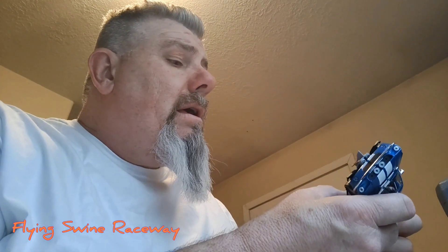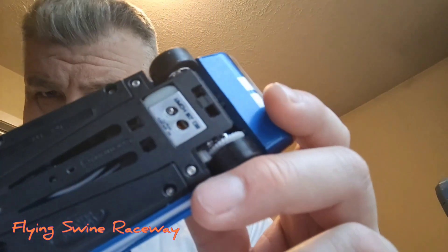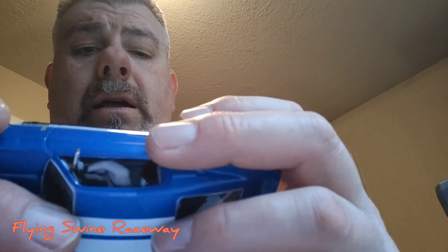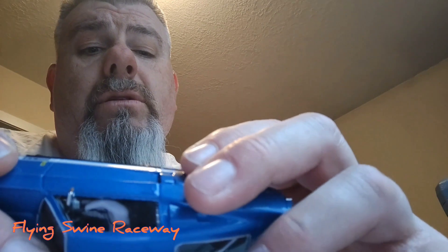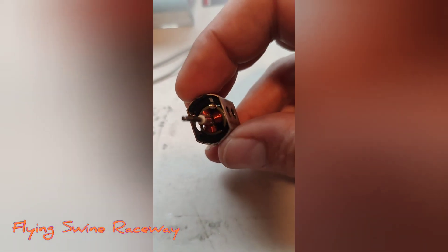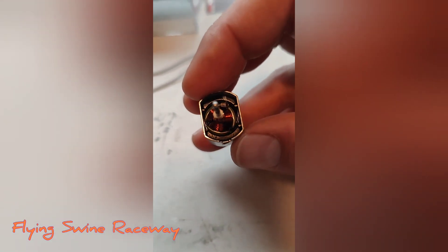Although — glad I didn't fire that up. Look down at the motor. That is a screw down in there. How did that get in there? There's no screws — where did the screw go? I'm going to have to pull that apart and take a look. I'm not going to run that car. Now the screw's gone, I don't know where the screw went. Going to have to pull the motor apart and take the end bell off. That's a grub screw — in the assembly process or something, that's what was down in there.